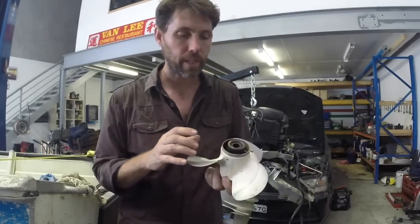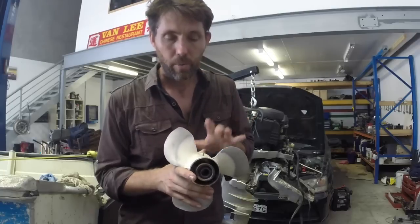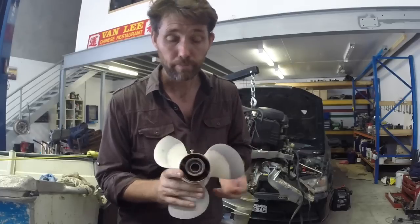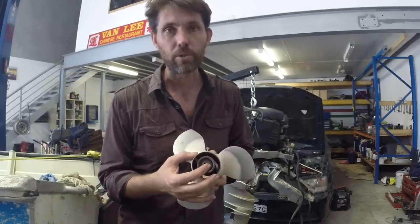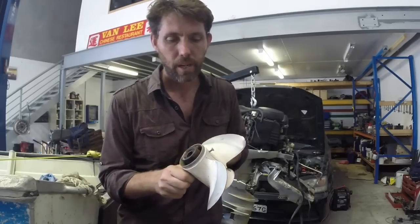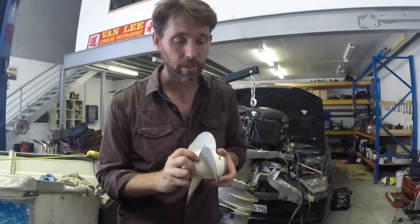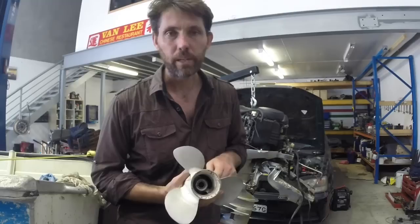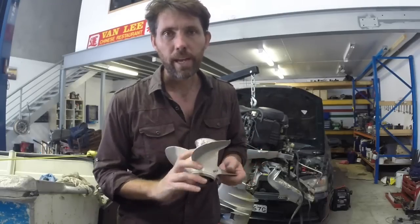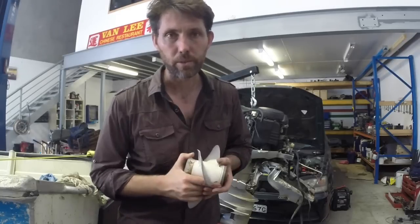So that's the bodge way to fix up a propeller that's had a spun bushing — it's slipping. I wouldn't trust it a lot though. It can be too loose and can still slip, or it can end up holding so strongly that if you hit something you risk damaging the gearbox. So use this as a bit of an emergency fix. But if you don't have a prop available, a hand drill and three screws can get you back on the water — if you've traveled a long way to get to some lake in the middle of nowhere and you want to use your boat. It's well worth knowing this, but just use caution.